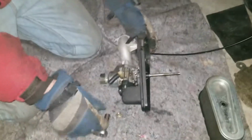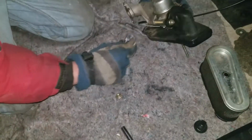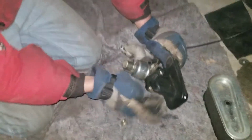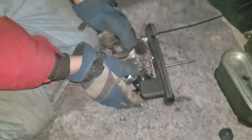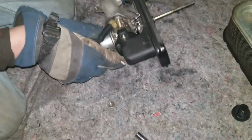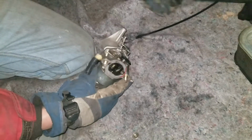Okay, yeah, like you said, if your mower gets stuck with the throttle wide open, it'll go straight to 10 grand, it'll just pinpoint out, then you need to definitely look into it. If your governor is free, like if your butterfly moves just fine and you tried moving that and your throttle does not go down, your RPMs, then you should definitely pull this cover off. It'll be in the motor. You can actually look at this one right here.